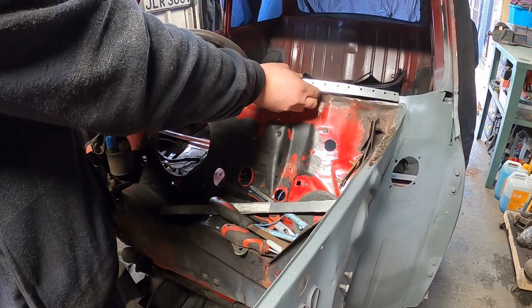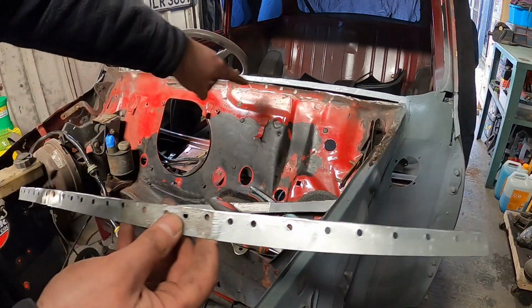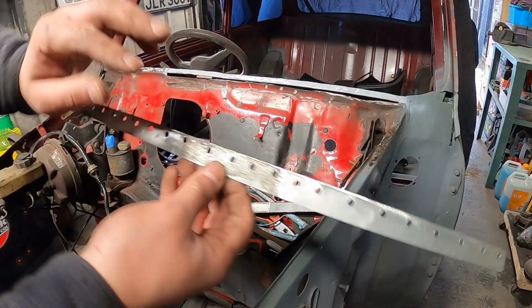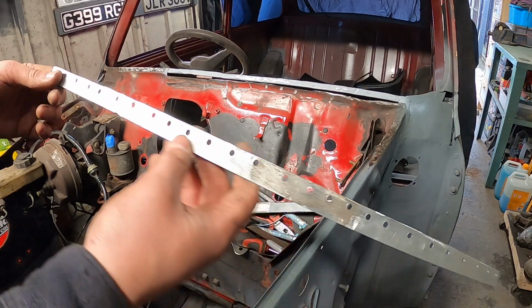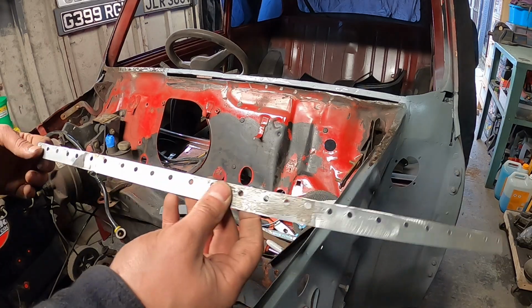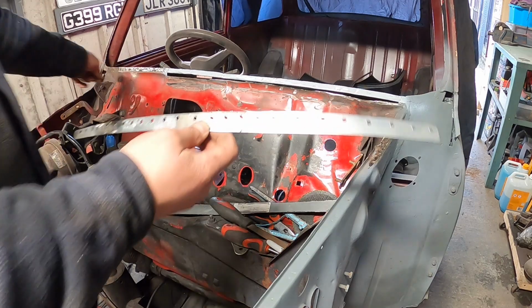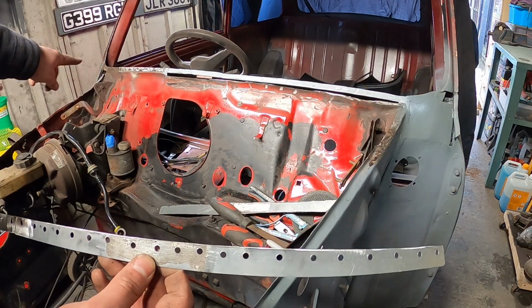from being on there. So that paint's still wet, so I won't set it on there, but it still needs a little bit of trimming. I need to take a little bit of this metal off and I need to fettle it. But what I'm going to do is start welding it in. Obviously you can see that replaces that complete lip all the way along there. And then we'll do it in two sections, like I said, and we'll carry on doing that piece over there.